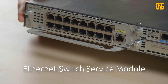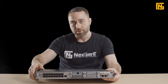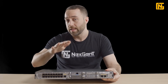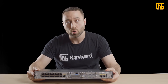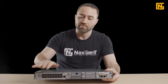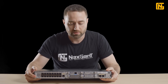So this is an entire Ethernet switch plugged into this router. Why would we have a switch as part of a router? Well, this router is actually a branch router. Let's say you have a bank with a branch office — at that branch you're going to need a device to handle all the network connections. We have a branch router that handles routing, but we can also slide a switch in here to support hosts, all within the same device. It saves us space and equipment. I'll pull the switch out so you can see it comes out of the router chassis.